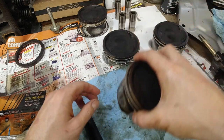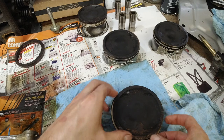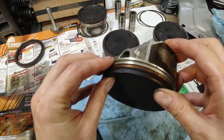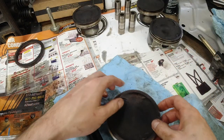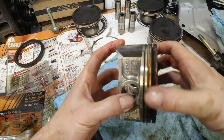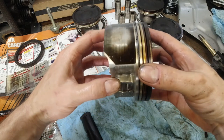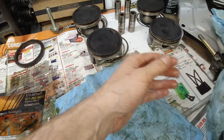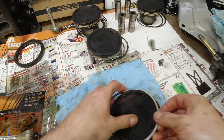Number two. Number two was 90 or 95, it was one of the lower ones. As far as compression goes, ring seems okay. Forget the oil ring. Number two seems okay. Okay, number three. Number three was the best of the bunch at 120 compression. Pass. And number four, the worst, I think,